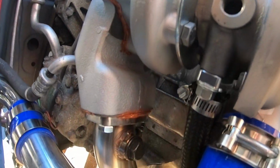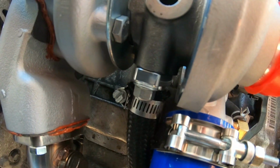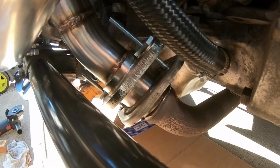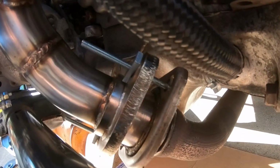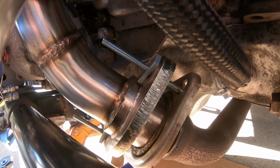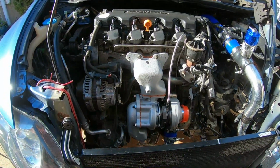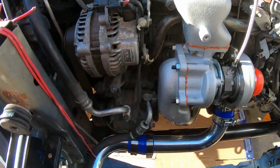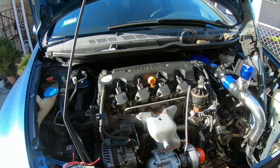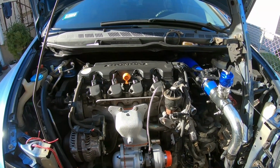I got it capped off over there. As you can see, I got a cap on there. And everything looks good. Drain looks good. That exhaust is working right now. I got that exhaust fitted, and I think that OEM donut gasket will work. The only thing I'm worried about now is I only got that factory exhaust and I'm boosted now, so I might just take off the axle back muffler just so we get rid of some of the restrictions.